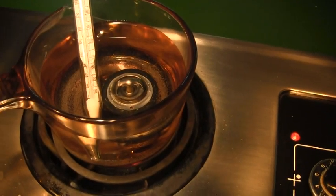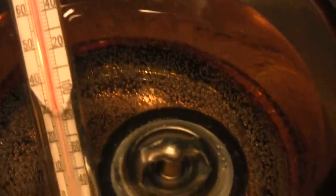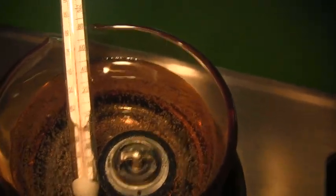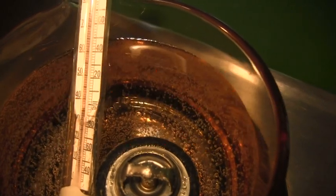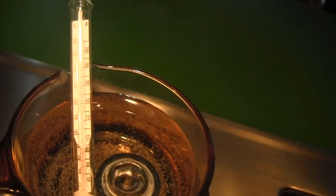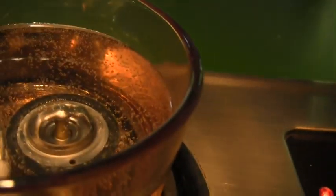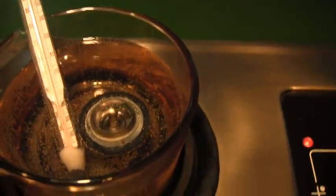We'll check that. We're at 150°F — about 66°C — and it's still closed. Now it's 170°F — about 77°C — and I don't see any indication of it opening. Okay, we're about 177°F and I can just barely start to see — the plate here is starting to drop in the center. I can see through the gap.